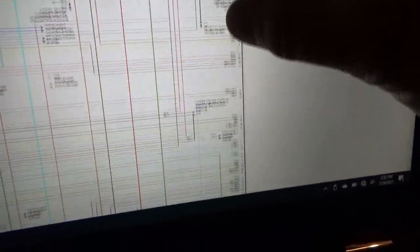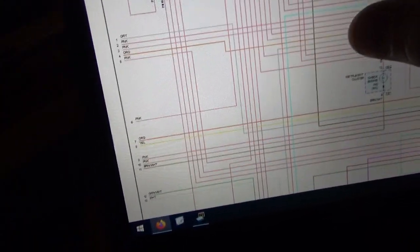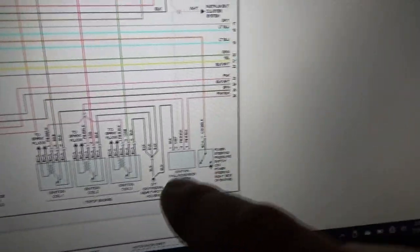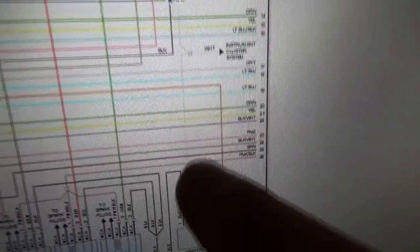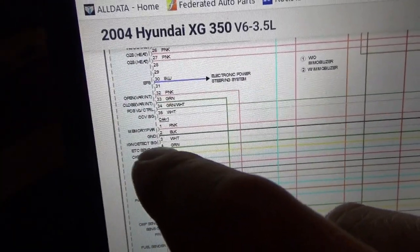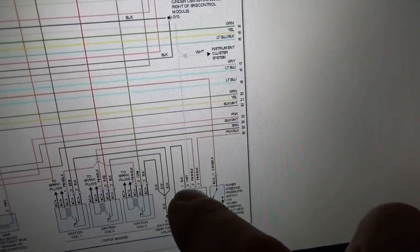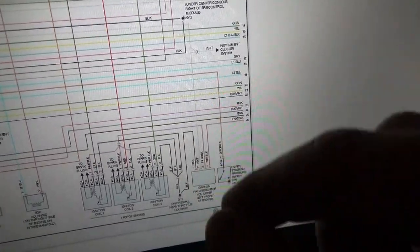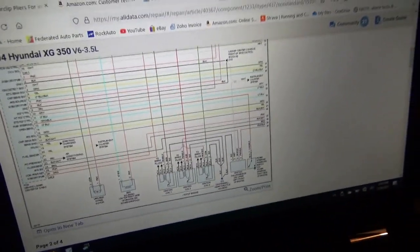Here's a wiring diagram. Here is the ignition coil fuse, here are the three ignition coils, and here is our ignition fail sensor. So power in, power out to the coils, a ground, and the white wire that goes to our instrument cluster and back to the computer — it says ignition detect signal, right there on pin three. Since the car runs fine, I'm not worried about the ignition coils themselves. I'm just worried about the sensor. So let's put a scope on two channels — the actual tach signal and the voltage going to the coils — and we should see little voltage drops whenever the coils are energized, and see if that output tach signal is correlated to the ignition coil firing events.